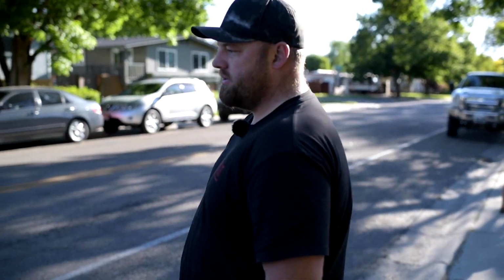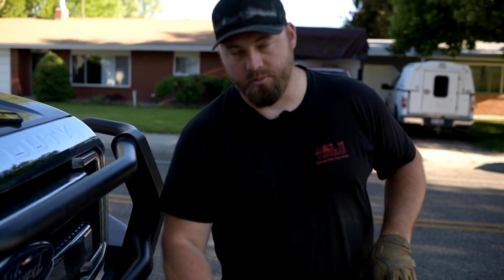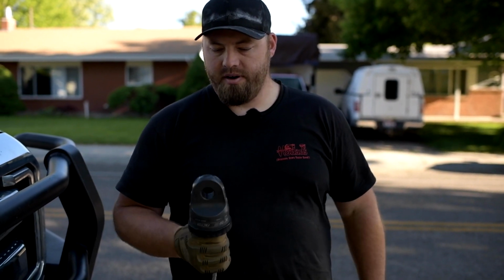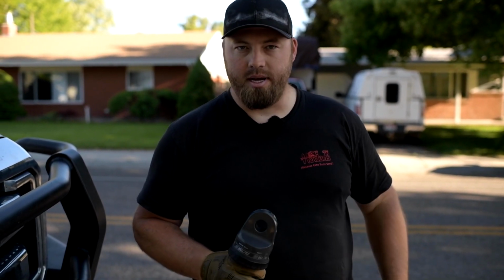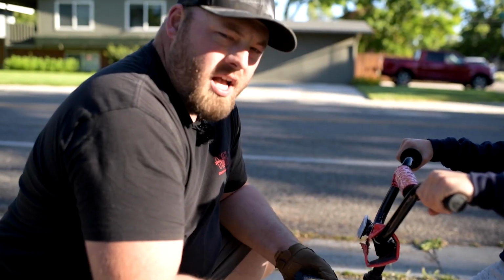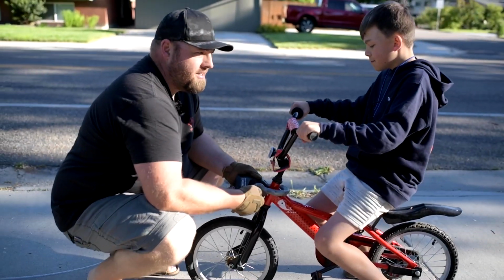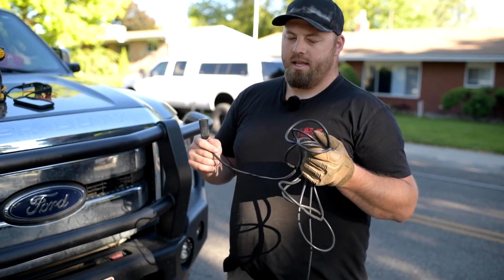Now, what you're going to want to do is unspool this all the way from the loop, so we can re-spool it to the actual winch drum. And when we re-spool it, we're going to want some tension. So we have a very special tension device that we're going to use to help get that line nice and straight. Just out of range. This is our winch cable tensioner, aka a bike with brakes. An essential piece of equipment you don't want to forget, the control switch.